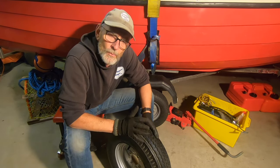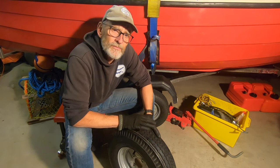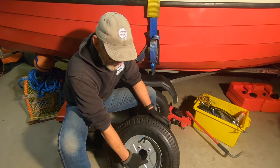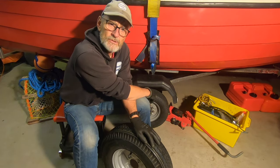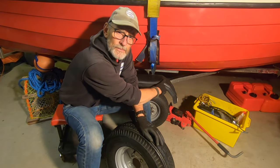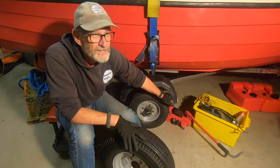With it being a bigger tire, you should be able to run it at a lower pressure — I'm going to try it at about 40 psi to begin with. The 4-inch hub configuration with the cutout for the grease nipple will actually fit straight on, but we've got 8-inch mudguards. There's a lot of space here — we may get away with it, but we might not.